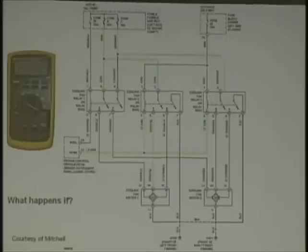All right, so we're looking at, as Charlie said, good voltage work. Voltage drop in the, let's see, we're on this, is that a 25 amp? Fuse 25, 10 amp. 10 volts, 200 millivolts on that brown wire. Where are we going in the relay? Look at this. What side of the relay is that? What's the thing with the little wiggly? What's that on a wire diagram? That's the coil, the control. And where does the other side of that coil go?